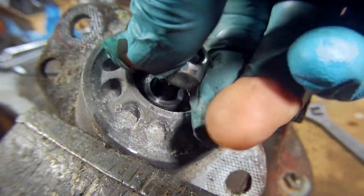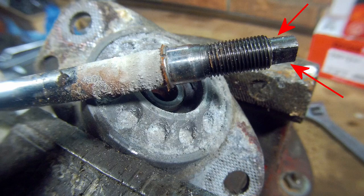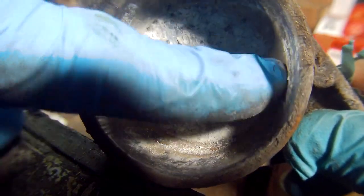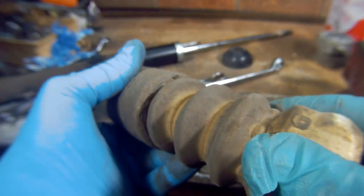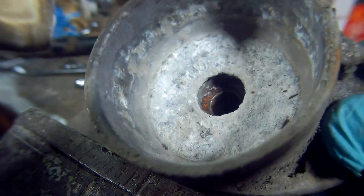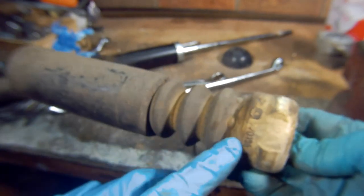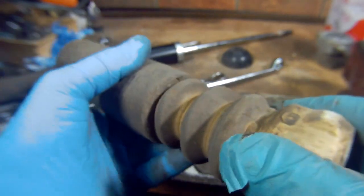Remove the nut and slide out the strut. If we look at the end of the shaft, we can see the two flats that hold the rod in place when you tighten the nut. Further down the shaft you can see the tiny snap ring collet that fits into a shoulder in the housing. If we look inside the housing we can see where the piston rod fits and the bump stop seats, which is a little bit corroded, but you'll want to be fitting the bump stop dry to eliminate any chance of it falling down the shaft. One thing that's quite common is the bump stop breaking where it joins against the plastic cover that protects the shaft from corrosion. This one's okay, so I just need to refit that.